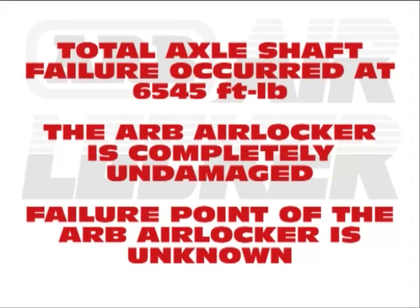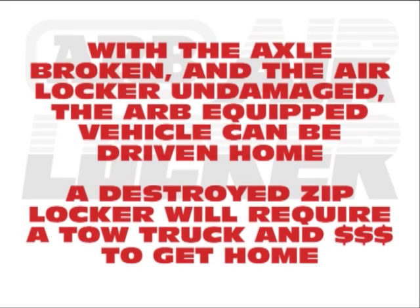Total axle shaft failure occurred at 6,545 foot-pounds. The ARB Air Locker is completely undamaged. Failure point of the ARB Air Locker is unknown. With the axle broken and the air locker undamaged, the ARB equipped vehicle can be driven home. A destroyed zip locker will require a tow truck and a lot of money to get home.